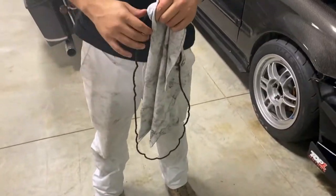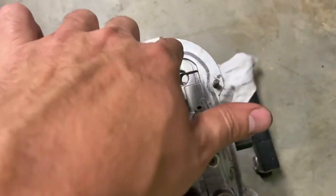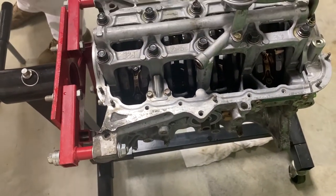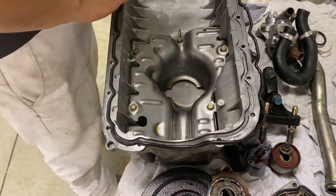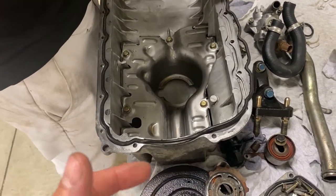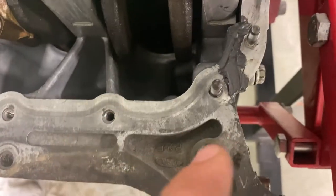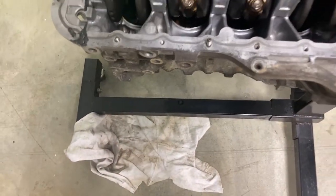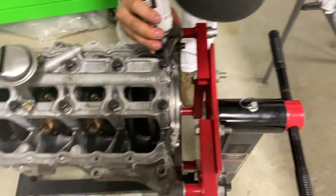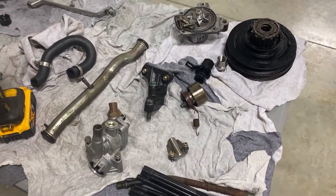What we're going to do now is put the oil pan seal in the pan, put a little dab of RTV in these areas right here so it doesn't leak, and then go ahead and slap the pan on because we are done in there. When you put your pan on one of these engines, take out your windage tray and make sure everything's clean underneath it — I've already done that. I really do like these O-ring style gaskets. Just a little dab of RTV in these areas where the surfaces meet the oil pump and the rear main seal, and then we lock it down with the hardware.